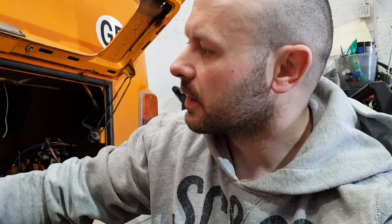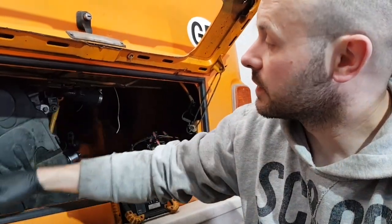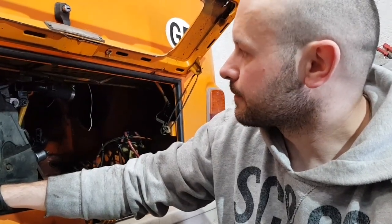We could run the radiator for the charge cooler here, because the initial idea was to run it at the rear of the car since there's lots of space there. We could actually run a normal intercooler because there is space between the engine and the radiator, but I don't think it's a great spot - it's inside the engine bay and the radiator next to it is going to get nice and hot. So a charge cooler is still the plan - I think it will be more efficient in this build.